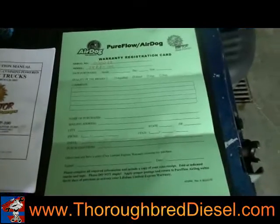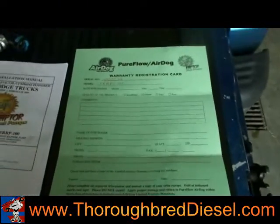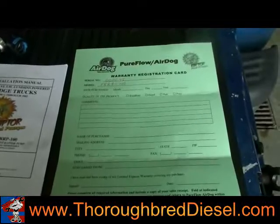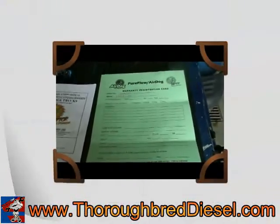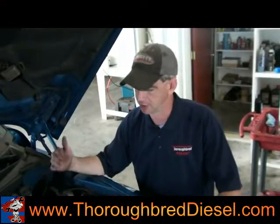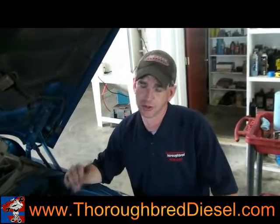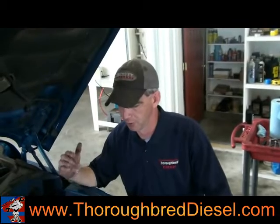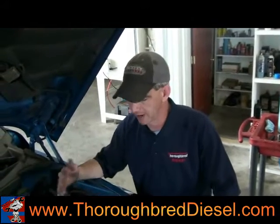On the install today, we're going to show you a few basic things that we haven't covered in some of our other videos, like how to check to see if you have a pump in the tank. The lift pump is the Achilles heel of the 98 to 02 Dodge trucks. Lack of fuel pressure is what always kills the VP44. They're a fuel-cooled pump. If you don't have fuel pressure to them, you don't have a good pump.